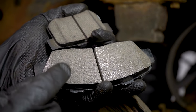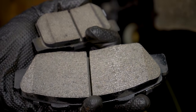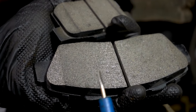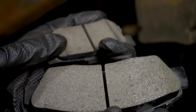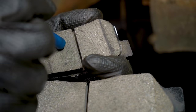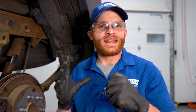Here's a look at a semi-metallic pad right here. As you can tell while I wiggle it around, you can see a whole bunch of light reflecting off the inner pad — that's because of all the metal flakes inside there. That's going to help with heat dissipation and make sure that the pads last a little bit longer. You could get some ceramic pads — looking at this one, you can see there's no reflection from the light on this one. I can take a magnet and it doesn't stick at all on the ceramic, but it sticks right to the semi-metallic pad. There are also other types of pads with different materials such as glass fiber, rubber, or even Kevlar, but those are less common. Most commonly in cars you're going to find semi-metallic or ceramic.